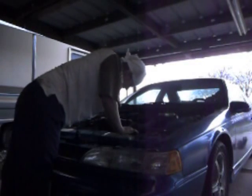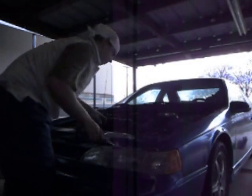It's always smart to move your radiator catch pan over a little bit whenever you're taking the lower hose off, because a lot of times they've got a lot more coolant in there and it'll spill everywhere, make a big mess. And it's gonna be a pain. So you get my channel locks and break it loose. And as typical on this car, it's gonna fight me. So cooler out of the way, it'll make my life easier.